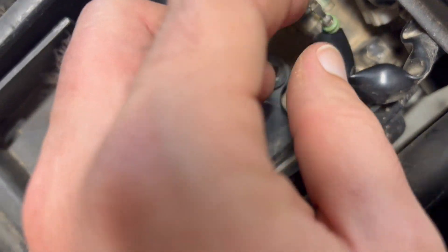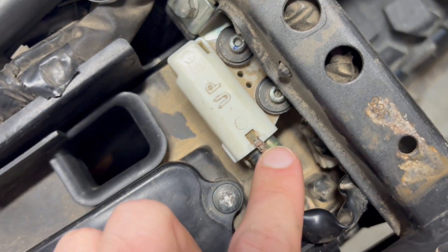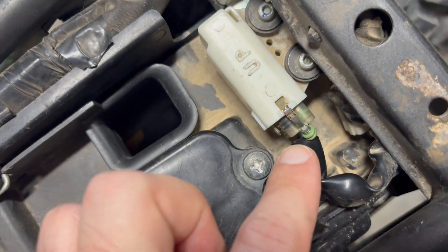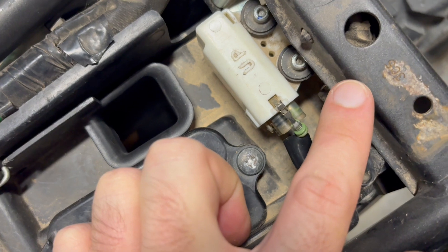It's just parked there. If you pull the plug out of the housing, there's no pin up in here, so that wire connects to nothing. If you ground this wire against the frame, then you can proceed to the next step.